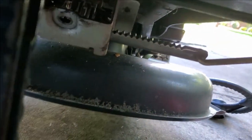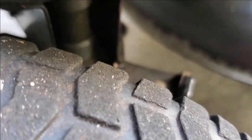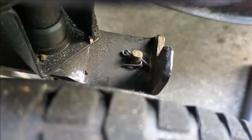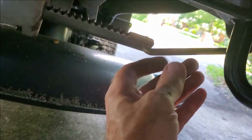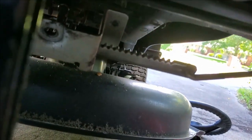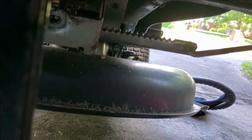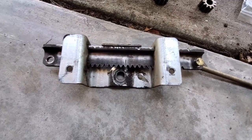I just cut the yard so I can wait a few days for the part to come and we'll get back to this. All you have to do is remove the split pin there — this will drop down on both sides — and then this whole piece will drop out so you'll be able to change that. It shouldn't take too long, but I'm going to go ahead and order the other part and come back to this in a couple of days.